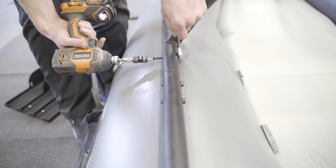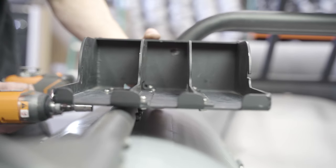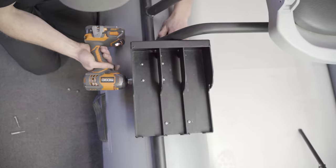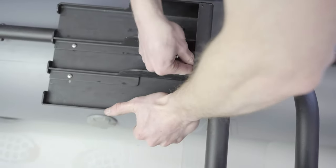Remove the bolts immediately behind the front seat on the left side of the craft. Align the frame mount clamps and install the bolts. Install the forward through bolts.